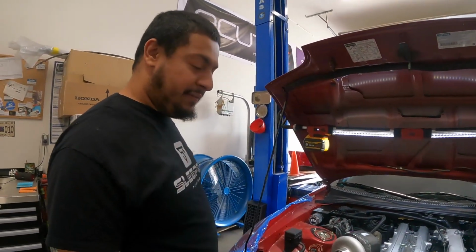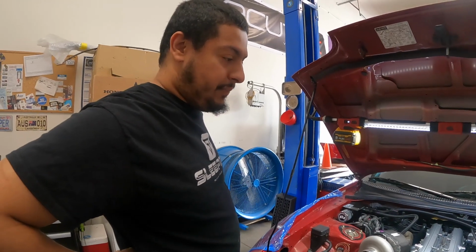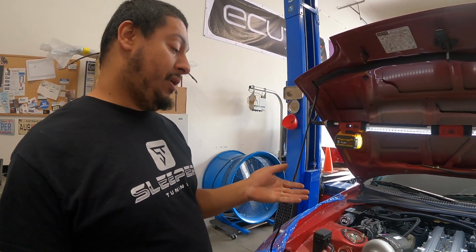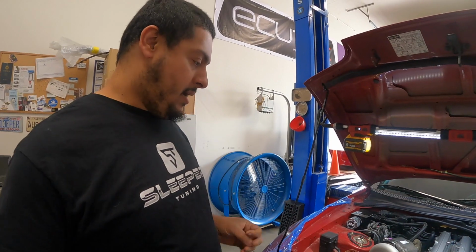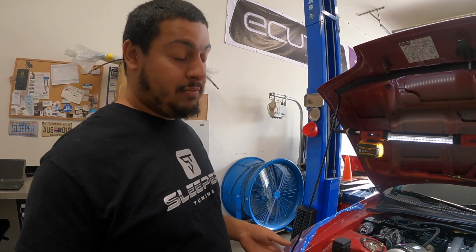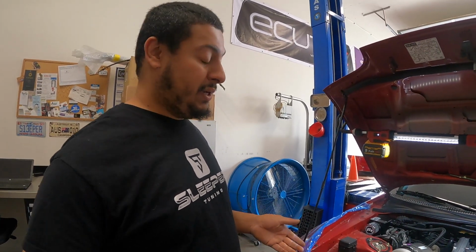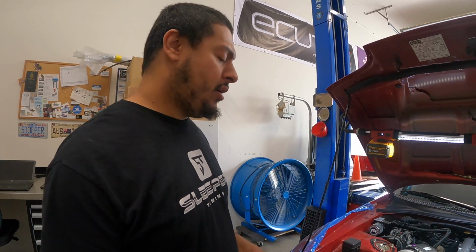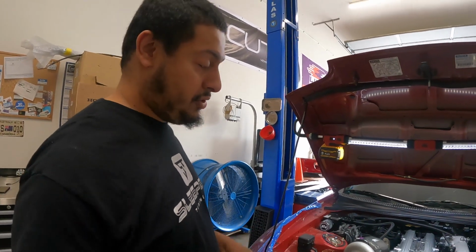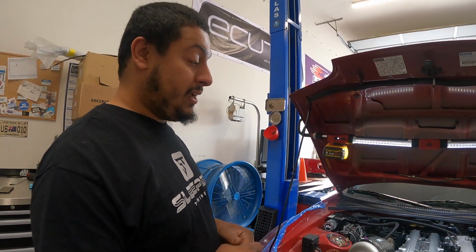All right, so unfortunately we have to swap the cams out on Albert's Supra. I guess there was a mix-up in part numbers or something when the engine was put together, and we ended up with a set of GE cams in the GTE engine. And although they physically fit, the issue you'll have is you won't get any cam sync, because of the tooth for the cam trigger. The air gap ends up like a half an inch, because since a GE is a distributor car, they don't have a cam sensor, so they don't fully make the provision for the tooth for a cam sensor.